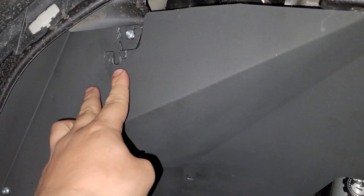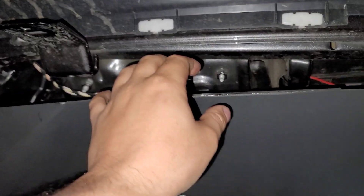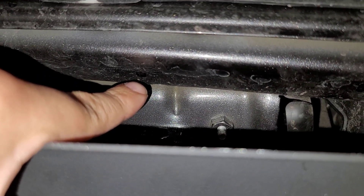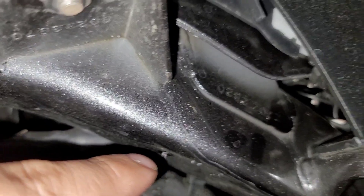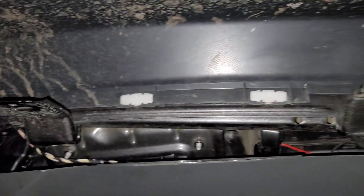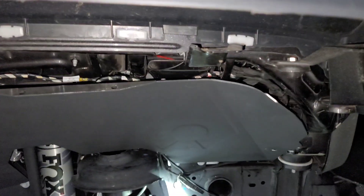I had to go to work for a bit but I'm back now. What I did was mount the big piece of the fender liner to the smaller piece, put it all together, and marked off where I need to drill. This big piece goes on top of the small piece and slides right into it — the tutorial didn't explain that part too well. I marked right there, there, and there for the rivets using a Sharpie, pressing everything tight since it's aluminum.